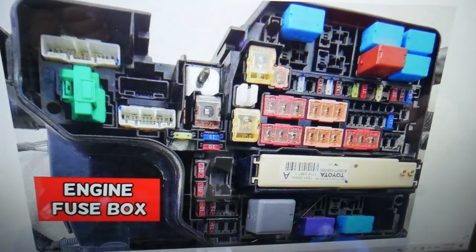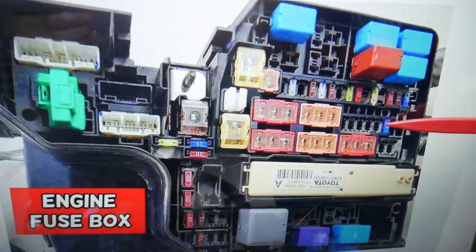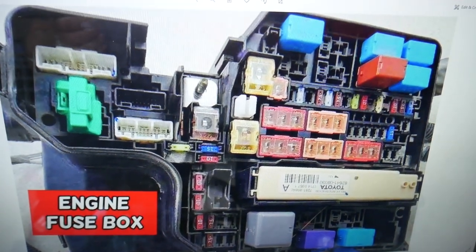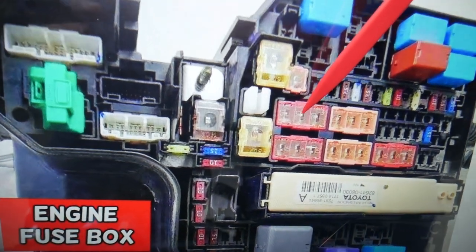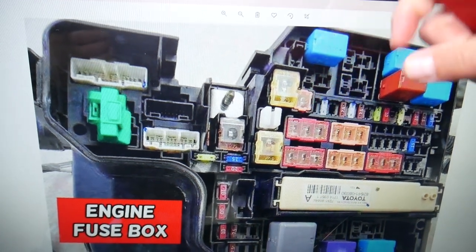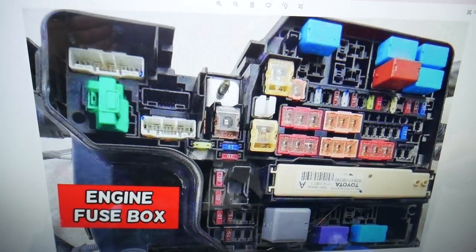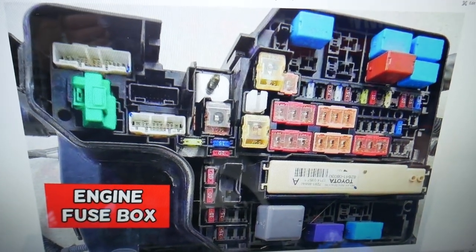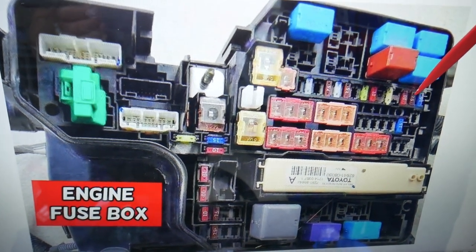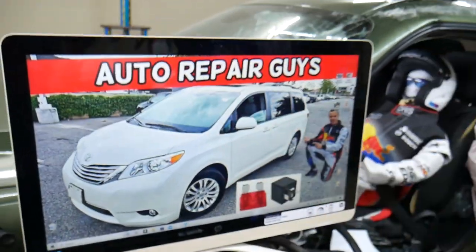Now, the fuses we need to check here — we'll zoom in a little bit. The first fuse to check is fuse number 25, that 15A fuse right here, the blue one. Then you need to check fuse number 33, that 30A fuse right here. If one of those burns you have to replace the whole fuse assembly — we'll put a link in the description below where you can get them at a good price with quick shipping. Another one to check is fuse number 37, that 7.5A fuse right here. Hopefully the video will be helpful — thank you for watching, see you next time.